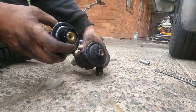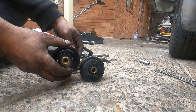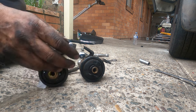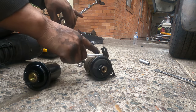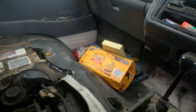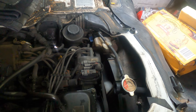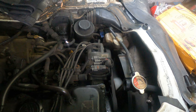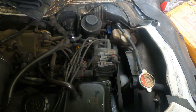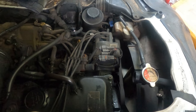So difficult, this one. Okay, this one is multi, you can go anywhere, so it's good. So I got in here and put number 10, put it up. It's all right. Gonna put on the starter, start it up, see how it is, see any fuel leak before we go for a test drive with a new clutch. Maybe it will not work at first because there's no pressure, no fuel in the fuel filter, so we have to do a few turns.